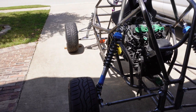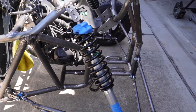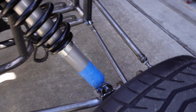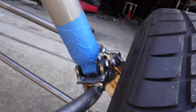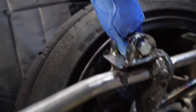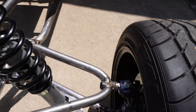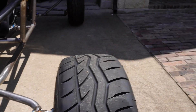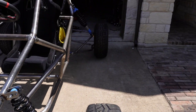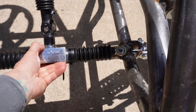It's been a long process trying to get everything situated, all the wheels square. I fixed all the suspension so the suspension looks good now. I made these brackets to put on so that the suspension can sit on these bars and travel the way it needs to. I rebuilt these for the seventh time and now they actually work right — they're pretty even and a lot shorter than they were. The front and back wheels actually somewhat line up now, which is good. Right now I'm working on this steering rack right here, trying to get the steering wheel all situated.